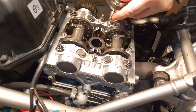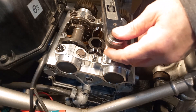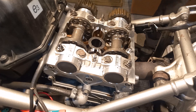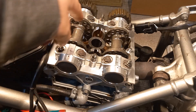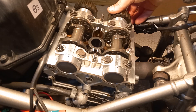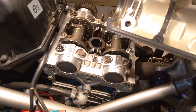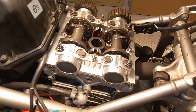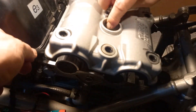Doing 22 newtons — these are all nicely torqued down. Supposed to do 10 and then 20 to 25 newtons as the final torque. We've oiled up the cams and put some oil on the cam lobes, just rubbed it in a bit. I've put a little bit of silicone in all the little corner pieces on the rubber and underneath the rubber, so that should stay in place.